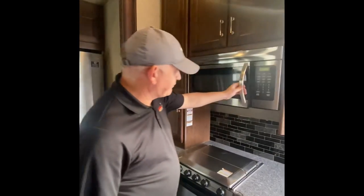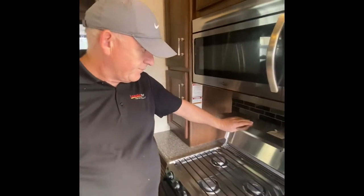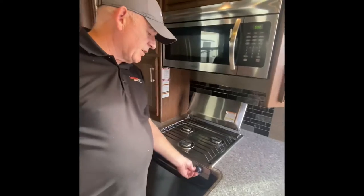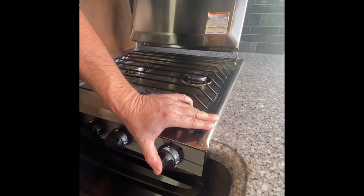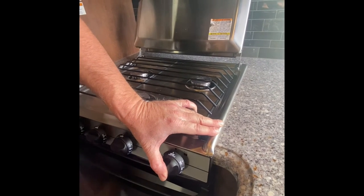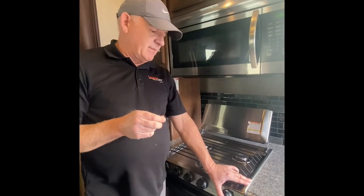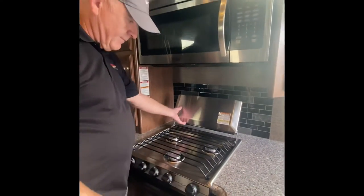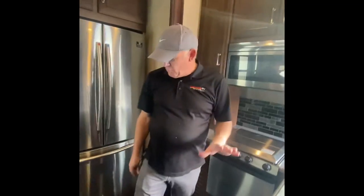Microwave convection oven here. You have vents, light switches, and your cooktop. We have three top burners. The oven is a bit different — pretty old school. We hold the pilot in for about 10 to 15 seconds, then light it, and hold the button still in to warm the thermal coupling. Once you've done that for about another 10 seconds, you can let go and set it to the temperature you want. There is a lot of cabinetry and a lot of storage inside this unit.